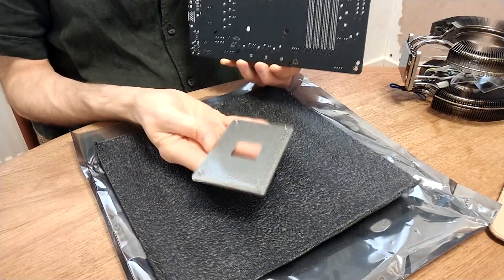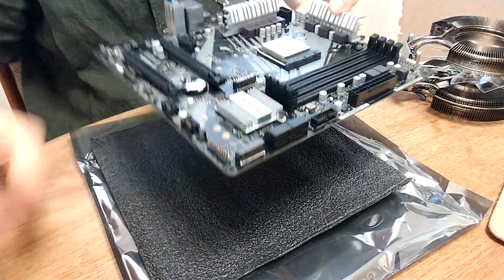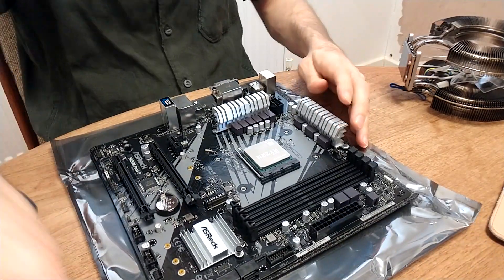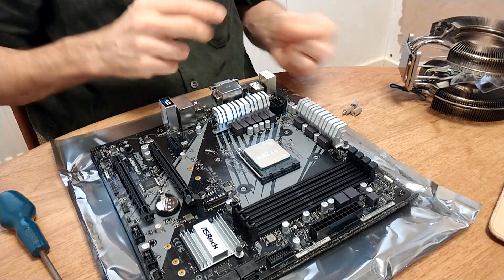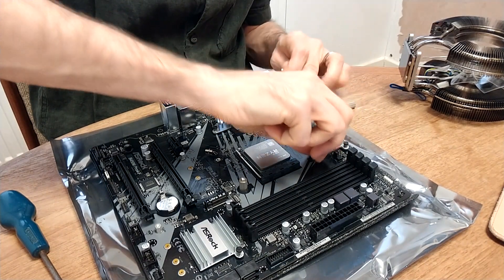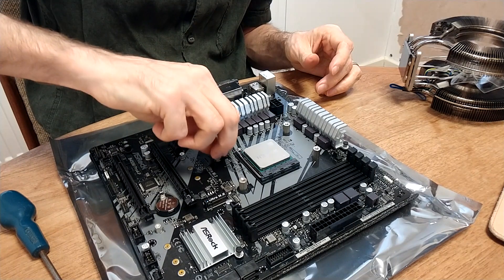Take your new back plate with the AM4 Zalman fitting kit, which of course you're going to need. Just place that so that the hole mounts come through the holes. Now you need the four binding posts which are supplied in the Zalman fitting kit. Just hand-screw those in. You don't need to tighten them up with a set of pliers — just tighten them up as tight as you can with your fingers, because that should be adequate.